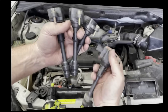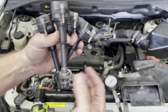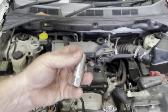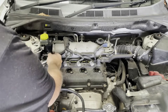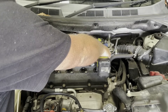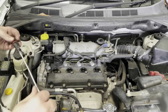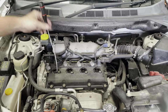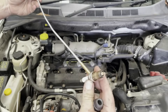The first thing I notice when I pull the coils out is that they're not drenched in oil or any sort of coolant or water, so that's a good sign. You're going to need a spark plug socket — a 16mm with a little bit of an extension bar. Come through and just loosen these all off. Now we've got them out but you can't quite reach, so what you need is a little magnetic pickup tool. Pop it in, pull the plug out, and it looks like fairly new spark plugs, so that's a bonus.